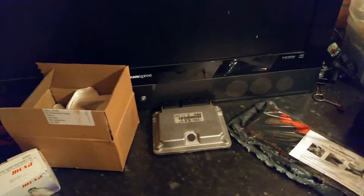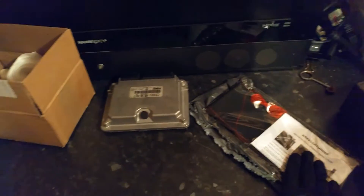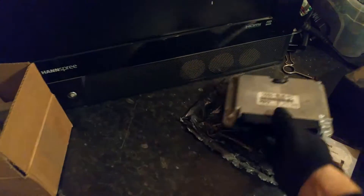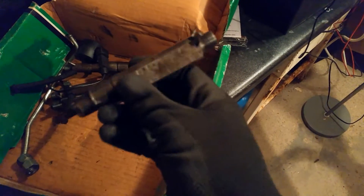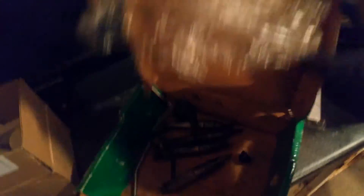I've just grabbed some parts to show you what's coming up in the next week, and some are longer term. I've just had this perforated steering wheel cover arrive — you have to sew these on. I've already got the leather steering wheel but it doesn't feel great, and the spare A3 has a better wheel but it's still not ideal. I've also got a spare ECU here which has been socketed and chipped with a remap. I can't fit it yet because I need to change over the injectors — these are used PP764 injectors I need to clean up and probably flow test.